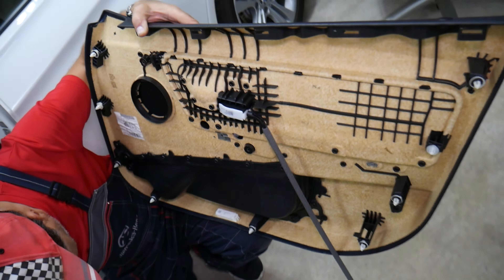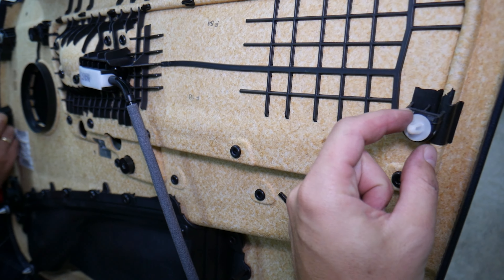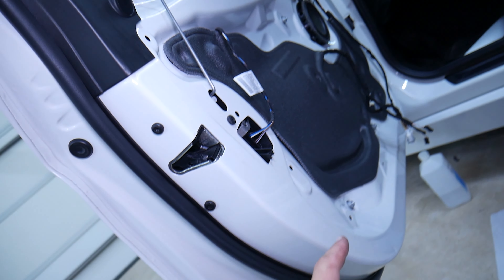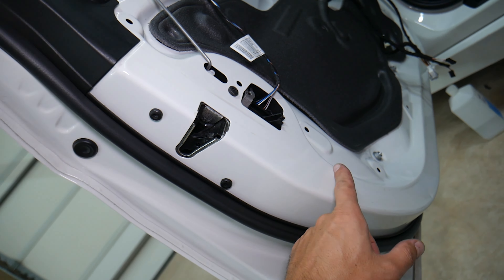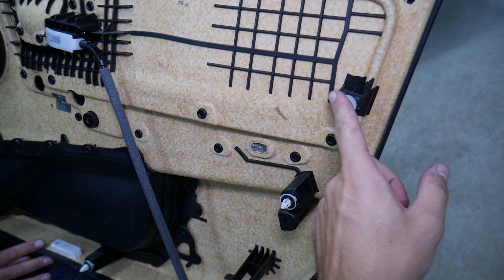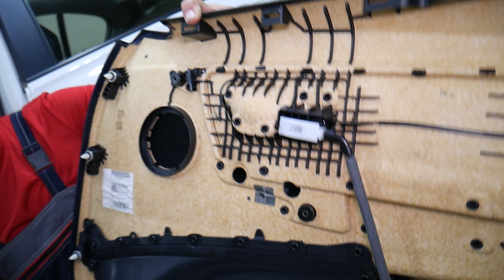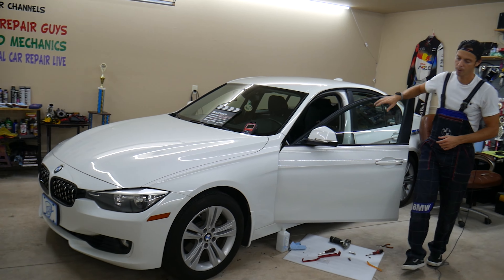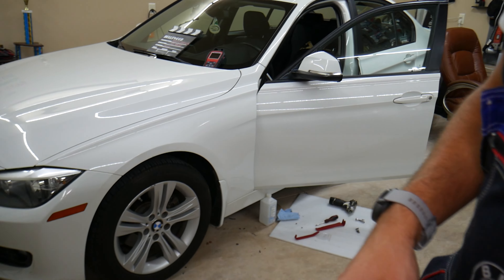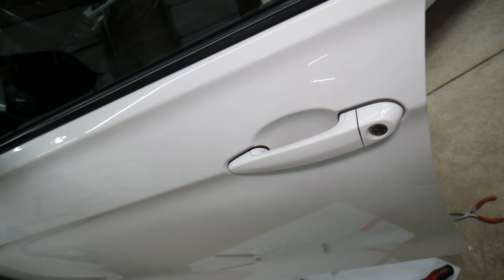Now watch — the clips sometimes have rubber bushings you need to install so the panel doesn't vibrate and cause noises later. If a clip came off and is stuck on the door, remove it and push it back onto the panel; if it's broken, replace it. We'll put a link in the description. Starting here, we have one, two, three, four, five, six, seven, eight, nine — nine clips total to remove that door panel. The 3 series and 4 series are exactly the same.